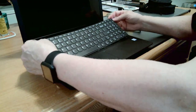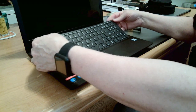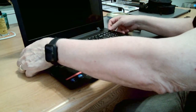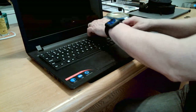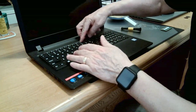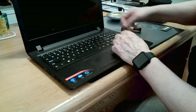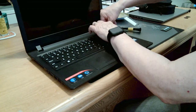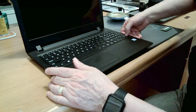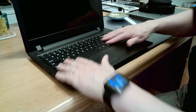We're going to flip the keyboard back over. You can see some notches right here on the bottom of the keyboard, so we're just going to work those back in underneath — make sure they're all underneath the frame of the keyboard. Put that in. Be careful not to accidentally hit the power button. We'll just start popping this keyboard back into place and you'll hear it snap all the way around. The last corner is by the power button. Everything looks good, nice and flush.